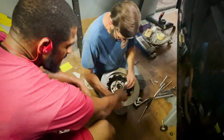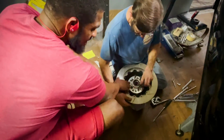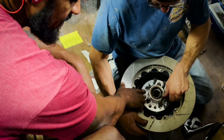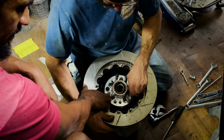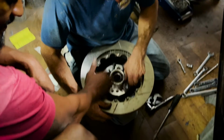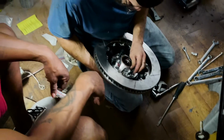And then another thing, when you buy the kit, it's two different bolt patterns. So it's either a 4 on 4.5 or a 4 on 4 3/4. So the factory was 4 on 4.5, but now you got options for wheel fitment. So I thought that was pretty cool just to bring it up.